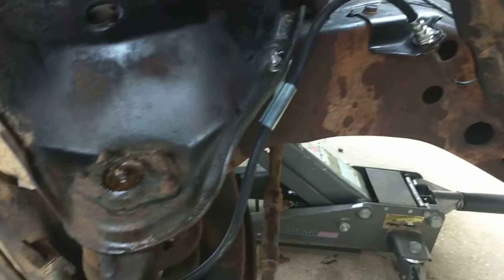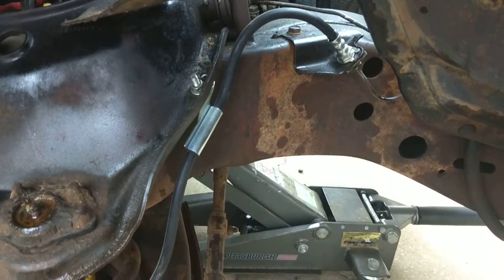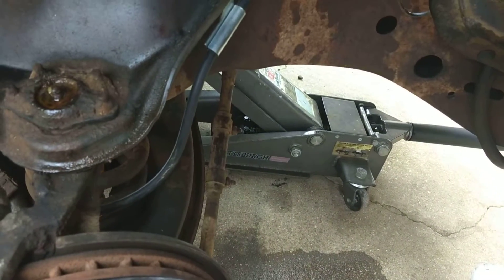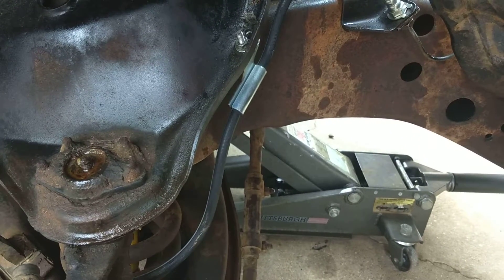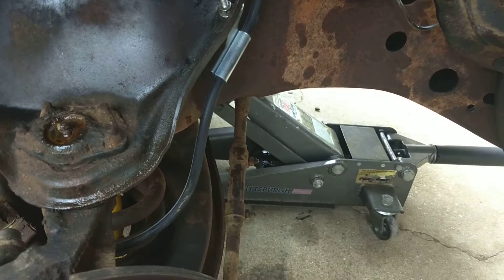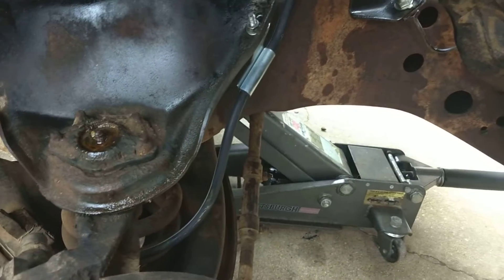Make sure you reinstall those brass washers on the new ones, and then bleed the brakes. That's just kind of a tip if anybody's interested and you're having to change that hose out — hopefully that helps you out. If you have any questions or comments just leave something below. Like the video if it was helpful.